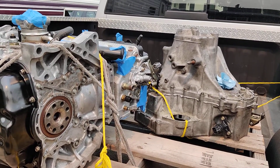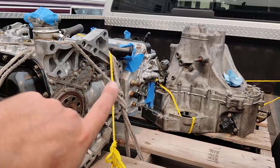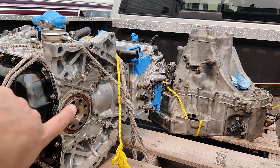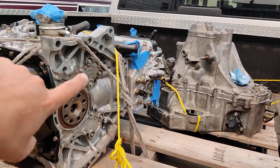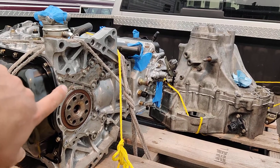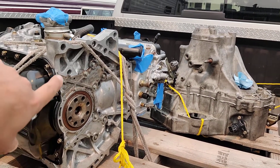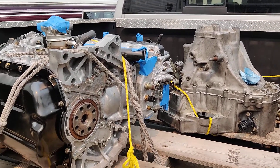He was out of his element and that was just a bad situation. On the engine stuff, he was also off from top dead center by a tooth. So the whole time I ran that last previous setup, I was running it with incorrect timing, and the engine was never timed to the ECU either because all the markings were missing. So that was a disaster.